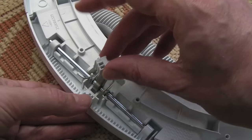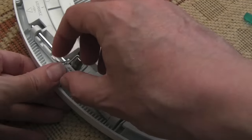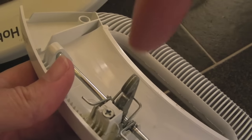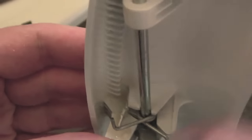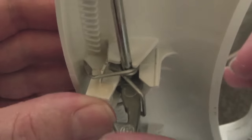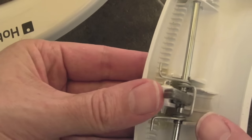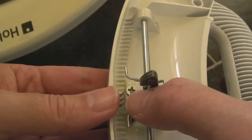It's brittle plastic, so you've got to be careful. I might need to widen the hole for the screw I use. Looking at the old handle, you can see there's a screw there — normally there isn't. I put a screw the full length of that piece of plastic down into the base. But as you can see, it's not held at all, even though I epoxied it as well — epoxy all around it and up the sides. The epoxy doesn't always stay in position. You can see where it's cracked again — it's been pushed this way. You can't epoxy these, you can't put a screw through them. Better just replace it.